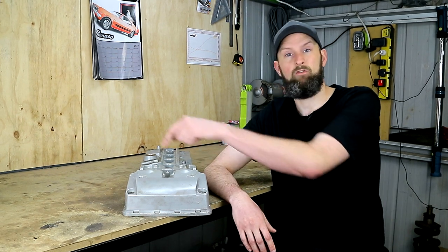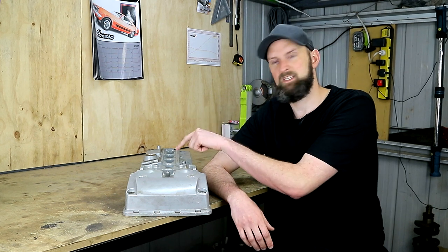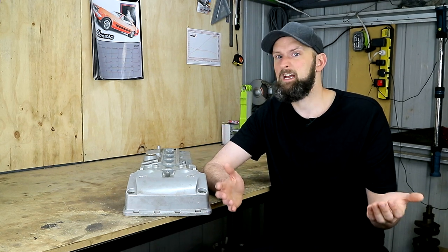We will of course show how to change all the rocker cover gaskets while we're in there, either as preventative maintenance as it is on this car, or if you've already found a leak and need to attend to it. These gaskets cover both the main rocker cover gasket that runs right the way around the outside, which if it fails should normally be fairly obvious — you'll see an oil leak from between this and the head, running down the side of your head and engine block. It also covers each of the gaskets for your spark plug holes, and if those fail, it can leak oil into your spark plugs, causing poor spark and misfire.